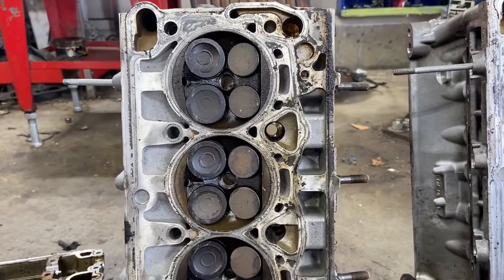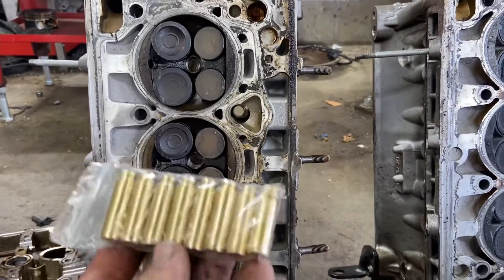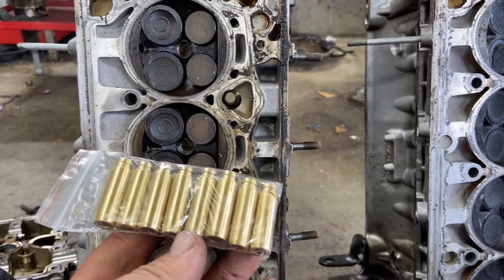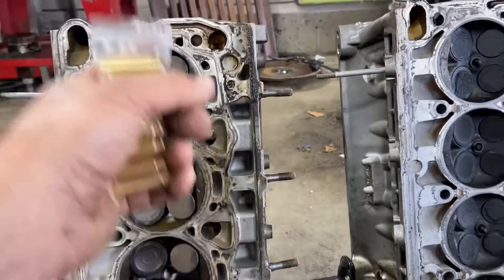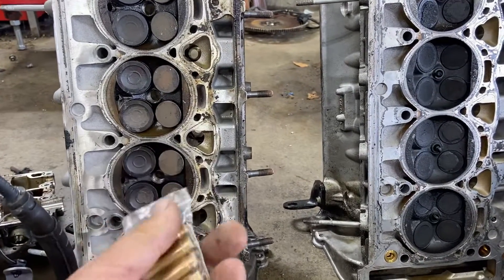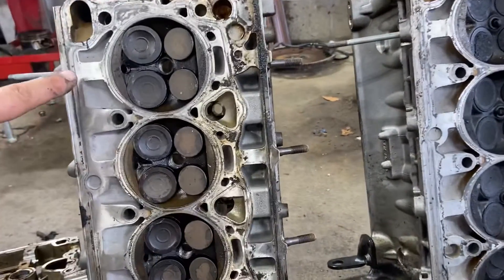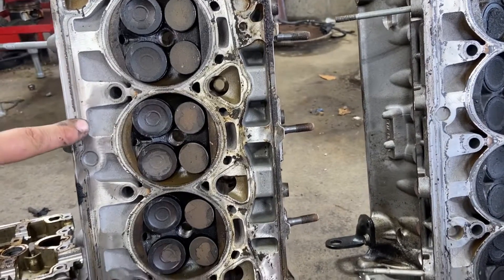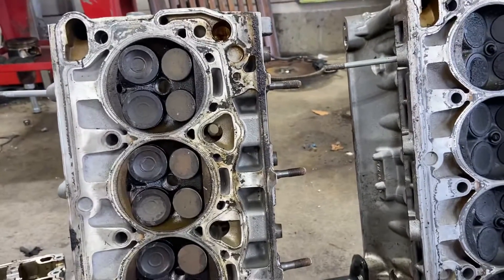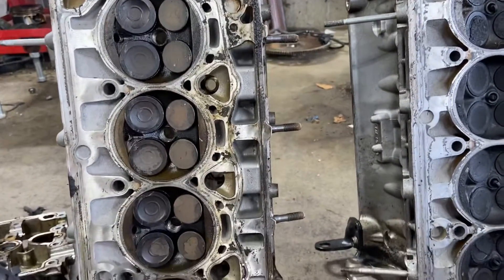Initially I was under the misconception that's why you needed new valve guides — because it bent inside there. But my cylinder head guy was always replacing just the exhaust valve guides. The cylinder head guys say that's pretty common — the exhaust guides are the ones that typically need replacing; the intake guides are typically good. Now in this particular head, someone used a whiz wheel — I do not recommend that. You can potentially get high or low spots and mess up your seal.